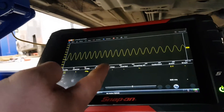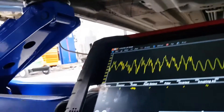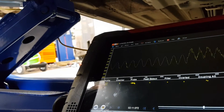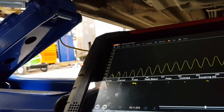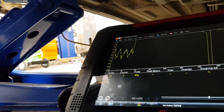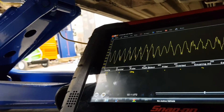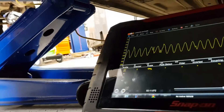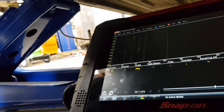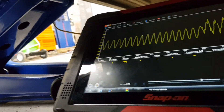So we've got the wheel spinning and you can see we've got a nice clean signal here. But with the wiring just up here, if I start moving it, just pulling and tugging at it a little bit, we can see that all going fuzzy. So I think we've got a broken connection inside of there. Luckily, that is part of the sensor — it goes from the hub all the way up into the car. So this car is going to want a new sensor. We can guarantee that from looking at our scope.